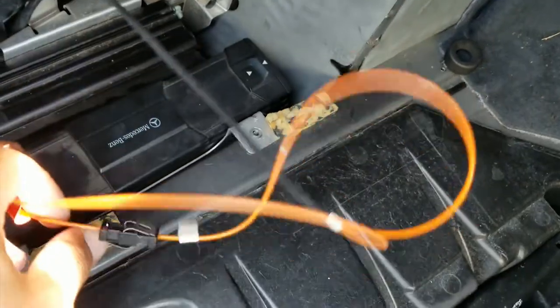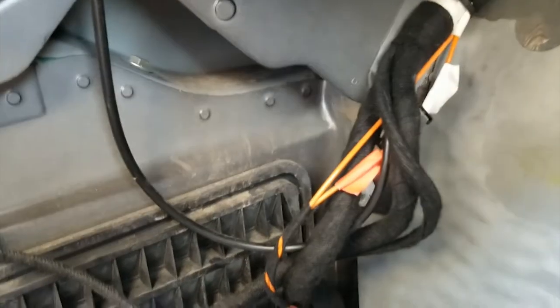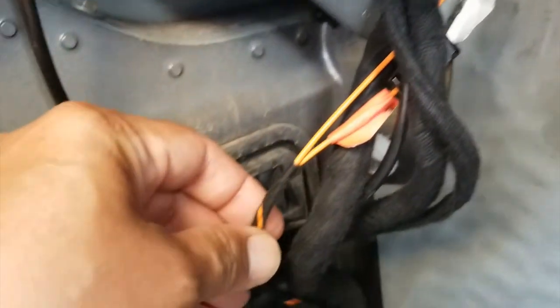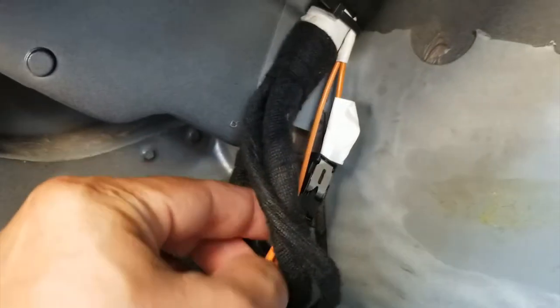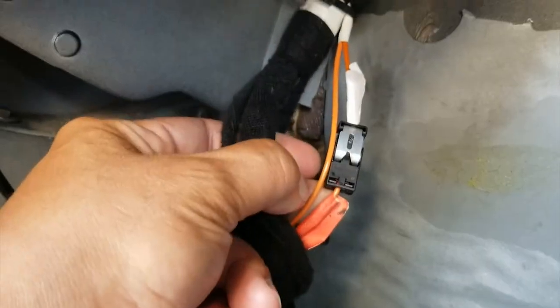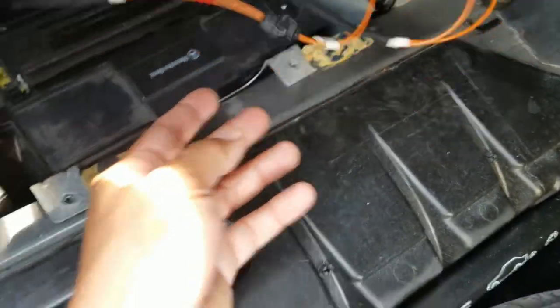But here's a fiber optic cable. I just so happened to take it out of the loop and put the two fiber optics that are originally closest to each other back together. Radio fired right up. So customer complained with no audio — I could see the problem.